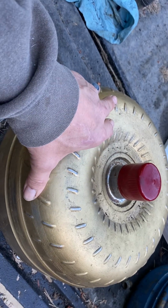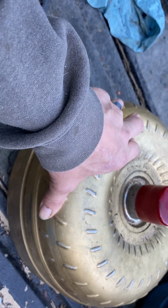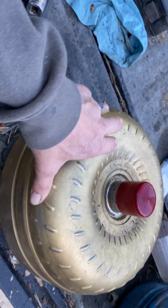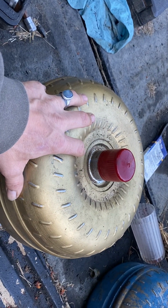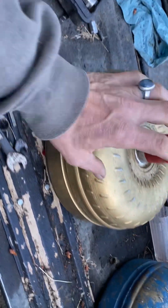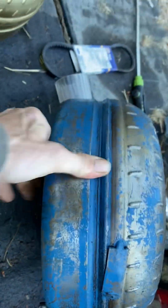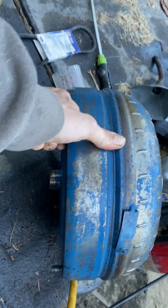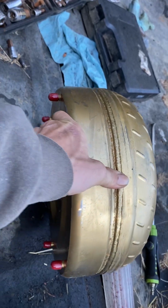This one should be back in, but the Monster transmission, here's a negative advertisement for a Monster transmission. They're months out. Brian ordered the transmission. We got the transmission. They sent the wrong torque converter. As you can see, Brian's torque converter is 4-bolt because it's an IDI. And they sent the 6-bolt, which bolts up to the Power Stroke.